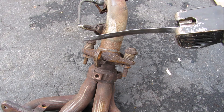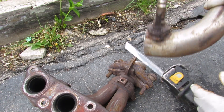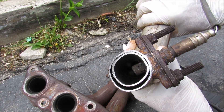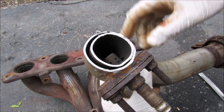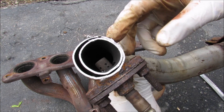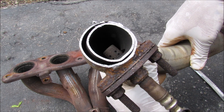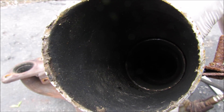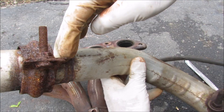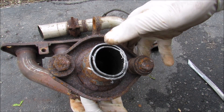Now I'm going to cut this open to see what it looks like inside. There's double walls! Inside the downpipe I was actually surprised because it is a double-walled pipe — that's why it was so difficult to cut through. You can also see the air-to-fuel sensor inside, which tells the computer if it's burning too lean or too rich. You can see the double wall on the other end here, running from about here all the way up to the top. And over here where the exhaust flange is, it's also double-walled.